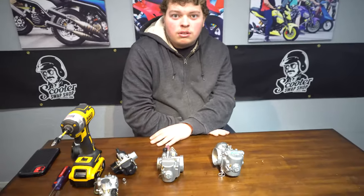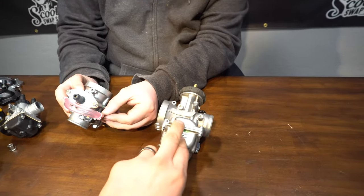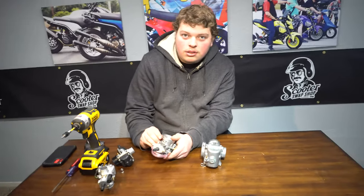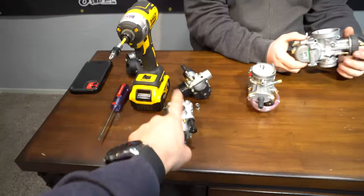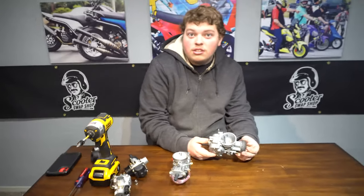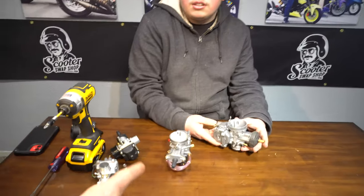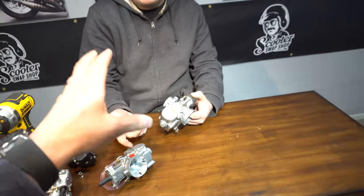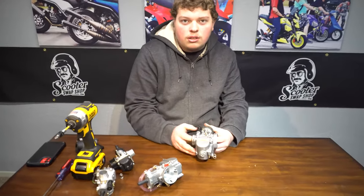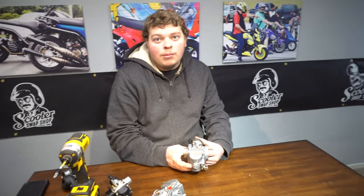You're going to see a lot of knockoff Keihins as well. They only sell for about 20 bucks less, so if you see a cheap Keihin on eBay it's fake — they do a really good job copying. I have yet to see fake CPs, but there are lots of fake Dellortos. If it's too cheap — or sometimes even the same price — it's fake. Buy from a reputable seller. You'll also see OKOs — they're basically a copy of this style carb, made in Taiwan, but then there are copies of copies made in China. You end up buying the wrong part the first time, getting frustrated, then buying the right part the second time when you could have just had the right part from the start.